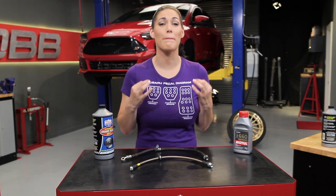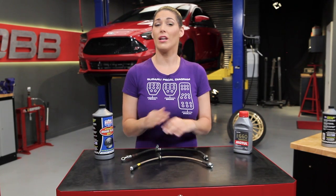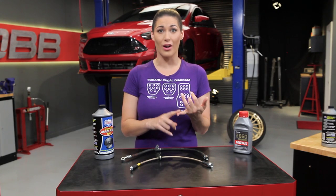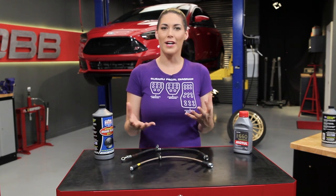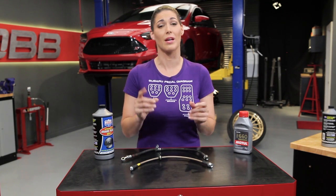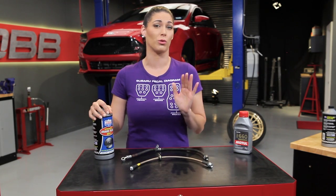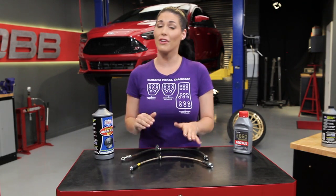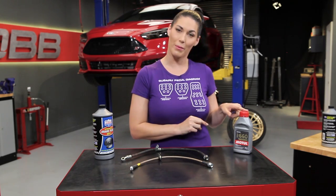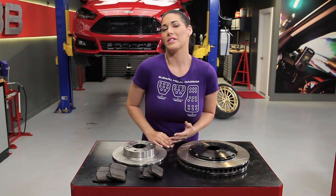For more information on bleeding your brake lines, visit the extra credit below. With heavy use, the fluid can boil inside the caliper — just like with any other boiling fluid, gas is a byproduct. The only thing we want in our brake lines is fluid — no air, no gas. So if you're in there changing the lines and bleeding the system, this is a good time to upgrade your fluid, because some fluids can handle heat better than others. The OEM fluid is perfectly fine for normal driving conditions, however if you're going to be hitting your brakes often and hard, you might want to consider upgrading.